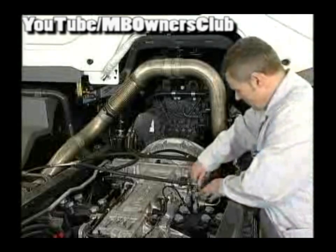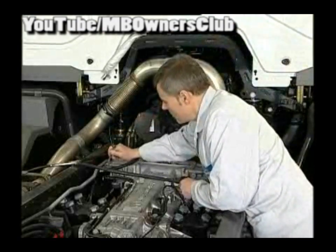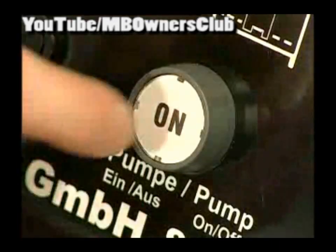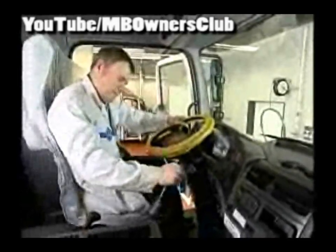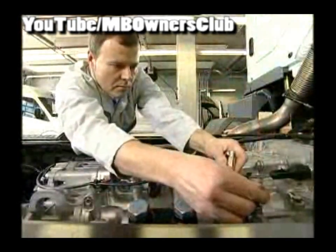When there is no more air to be seen, the bleed screws and bleed valves are closed once again. Now you can switch off the bleeding device, so that the gear can center itself and you can check whether the bleeding was successful. Move the gear shift in all directions in rapid succession at least 10 times to the left and right and forward and back. If the gears are not exact, or the change is too soft, or both, then the gears must be aired once more. Only after a successful bleeding is the bleed hose disconnected. Don't forget to put back the protective caps.